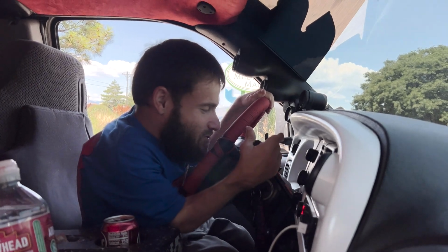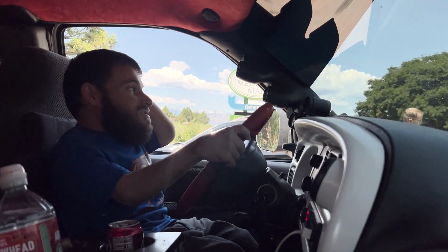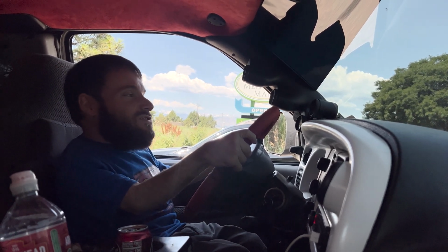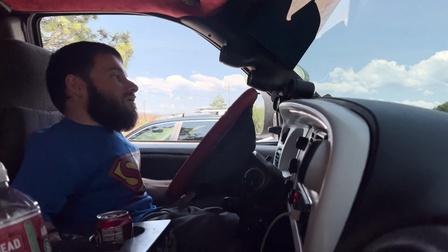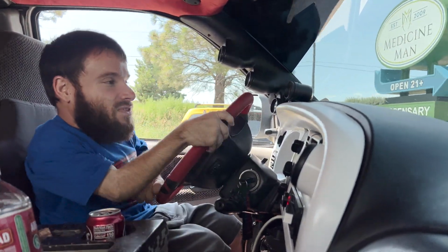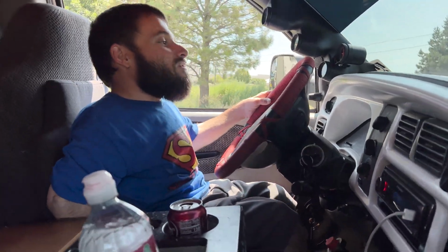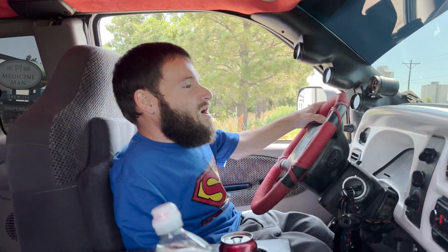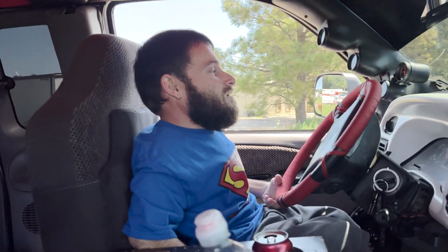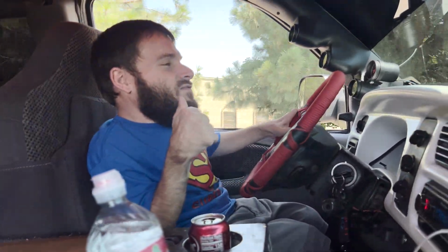But the pop pressure is readjusted with this set, so you'll notice it's, I'll let this person go first. So we make loud jabbing exhaust noises. Alright, so you'll notice I can turn out of here, and you can sit there and flop the gas all you want, and it's just fine. We'll pull up to even more of an incline over here. Alright, now the last pop pressure is guaranteed that if I just drop it and let off like that, any of that at low speed, it would guaranteed shut off, and I'd have been rolling backwards down that hill. So, we definitely fixed that issue for sure.